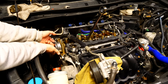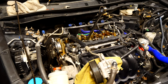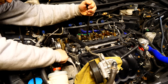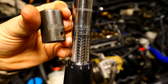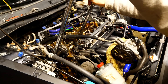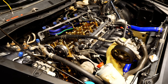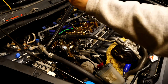With the bolt loosened I pulled the old VTC actuator off the cam and slid the new one onto the intake camshaft. If you purchase the new VTC actuator from the same place I did — link in the description — it comes with a brand new bolt. Thread it into the intake cam, then use a torque wrench with a 17mm socket. It's a two-handed job: use a 15/16-inch wrench to hold the camshaft while you torque with the other hand. The VTC actuator bolt torque spec is 83 foot-pounds; the exhaust sprocket mounting bolt is 53 foot-pounds.